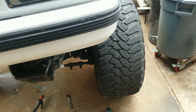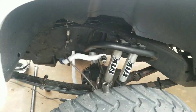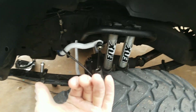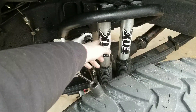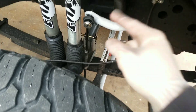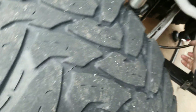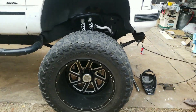I haven't really showed the truck that often, but I just got the sway bar installed yesterday. There looks like there's a slight clearance problem, but I measured it out and it runs parallel with the shocks, so as the shocks compress the sway bar just goes straight up like a normal sway bar. It looks like a small clearance issue especially on the passenger side — this side came out just a little closer. I had to cut the ears off, twist them, and reweld them, then make some custom links — ended up extending them about four inches. These are off-road design DOT approved brake lines, by the way — they're coated stainless steel.